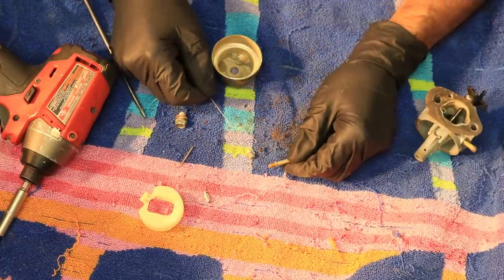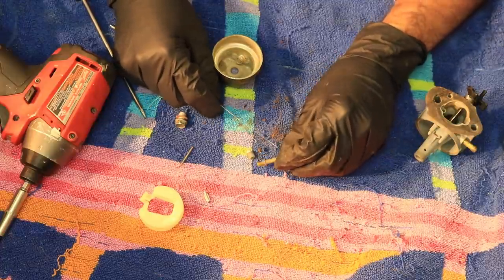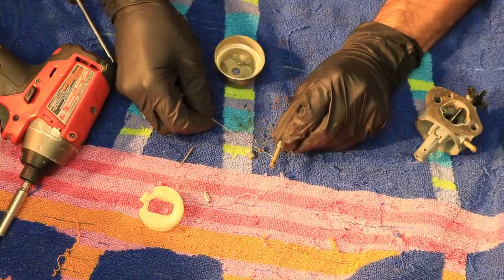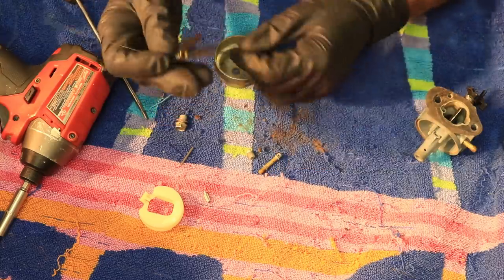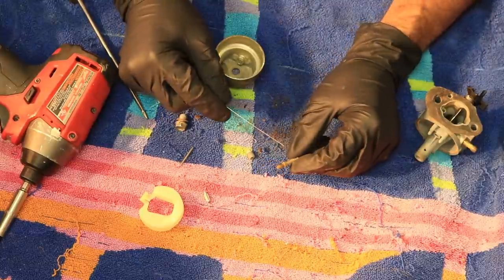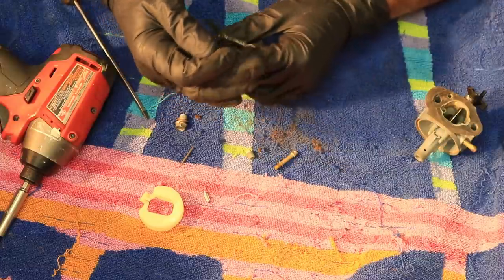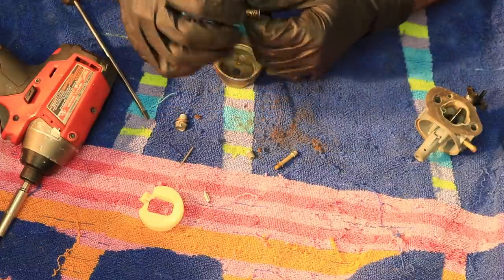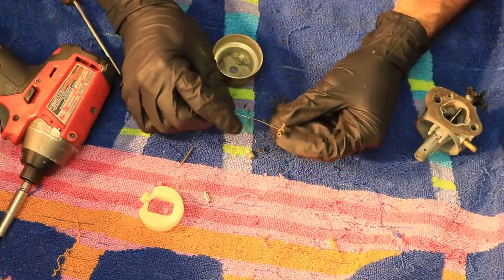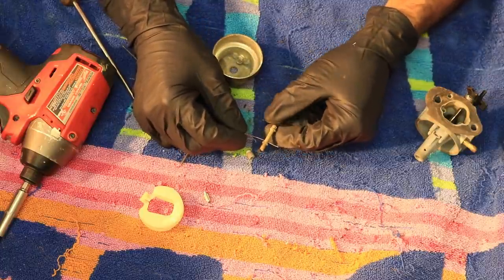On this, the emulsion tube — basically there's quite a few little holes here. I use a set like this, used for cleaning out torches; it works great on carburetors. I hardly ever use it on torches. Find one that fits through there, go down to the smallest one.